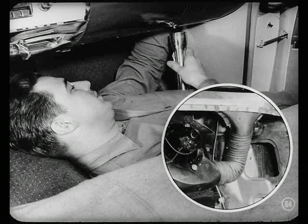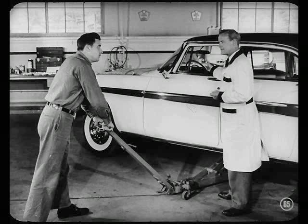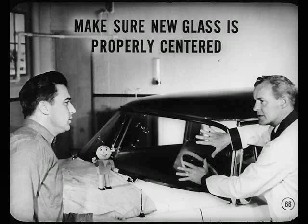No. You'd be smart to water test the windshield to make sure it's sealed up properly. To do this, you'd remove the flexible defroster hose at the right end of the duct. In addition, you'd raise the car from the left to make it lean slightly to the right and let any water that might get by run out the duct outlet. If it is watertight, then reinstall the moldings. Got that? Yep. Anything else on sealing at this point?